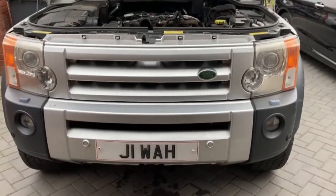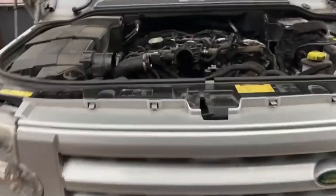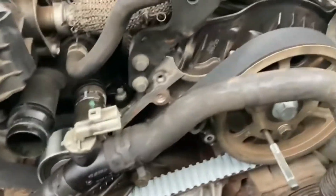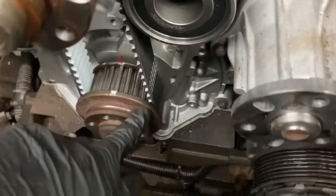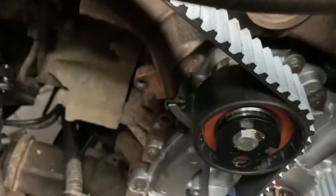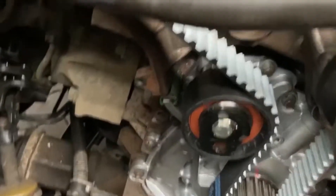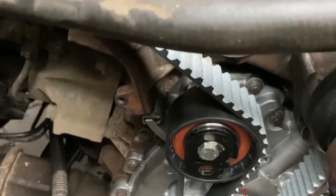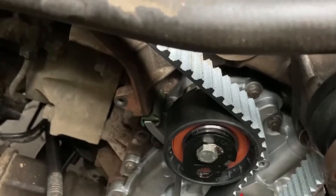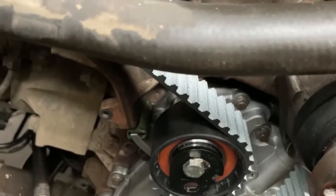Hello, my name is Hassan. This is one of my own cars and I'm doing a timing belt on it. These are quite common for the oil pump to fail at the same time. We've put the new timing belt in — the rollers, tensioner, and down the bottom. There is a brand new oil pump fitted, and it's the modified version so they don't break down as often. The problem with these oil pumps is that the tensioner sits on the oil pump, and when the oil pump casing cracks, the tensioner comes off, which damages the top of the engine and the valves.